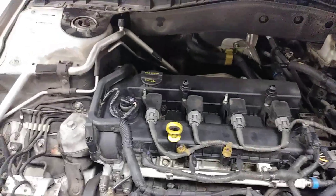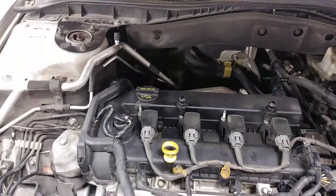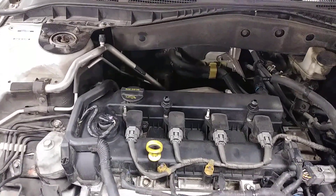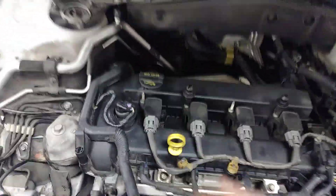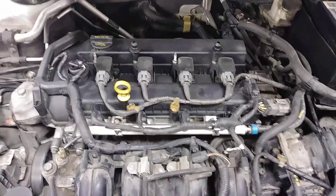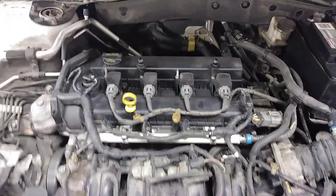To make the Mazda valve cover work with the newer solenoid on 2013 and up engines, you definitely have to run the smaller grommet. Some guys said they RTV'd it — maybe they did it like I did, or maybe they just filled the void with RTV between the grommet and solenoid. But there was quite a gap — it's a 4mm difference between the two solenoids — and I wasn't comfortable using silicone across that gap. I used a cordless drill with a carbide cutter to slowly grind off the lip.